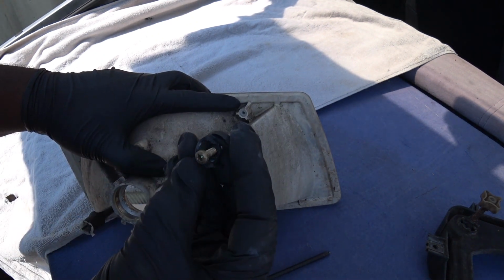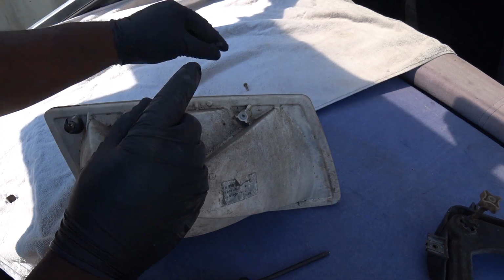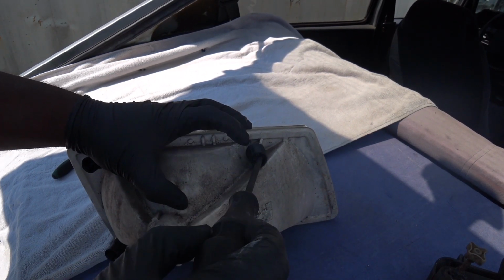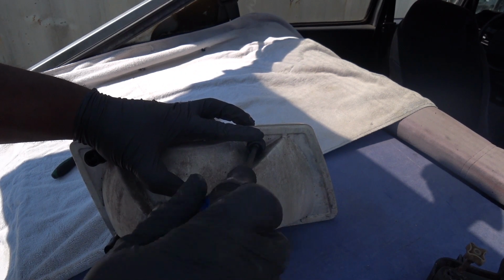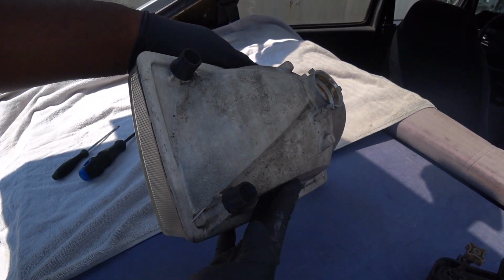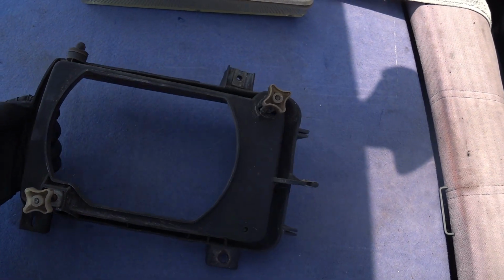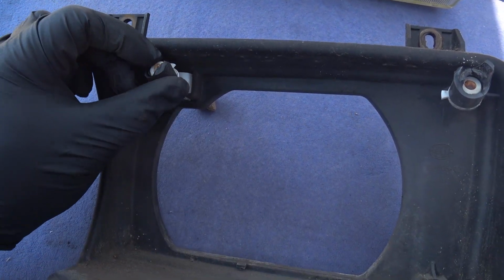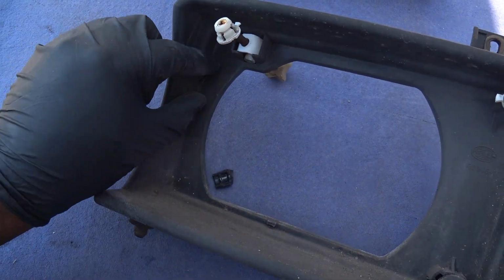In my case, all I had to really remove was what was left of the cones. Once removed, simply bolt on the new ones. Take a look at the remains of the headlamp adjusters. You can see just how easy and effortless it is to break this brittle 30-plus-year-old plastic off. You will need to pry the white sockets off the ball retainers because you will be replacing all of these.